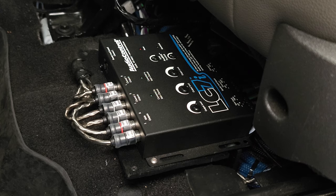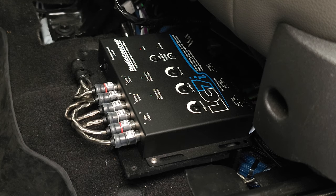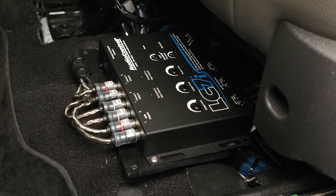I'm outside so please excuse any background noise. One reason I went with the LC7i instead of a Fix 86 or a DM608 by AudioControl was because I already had an LC6i. Unfortunately I dislocated one of the inputs because the wires were too tight, which pulled it out of its socket. I was able to put it back — it wasn't soldered off, just a connector that got dislocated. Make sure you give yourself enough wiggle room on these wires.